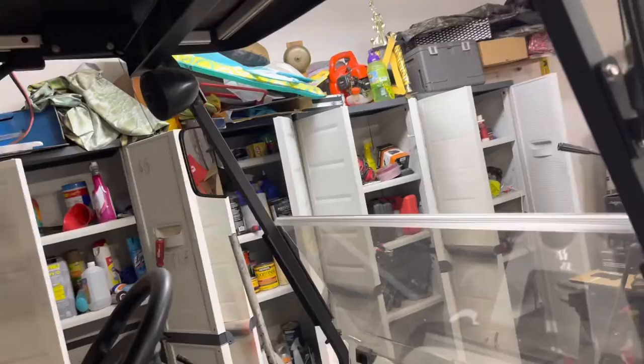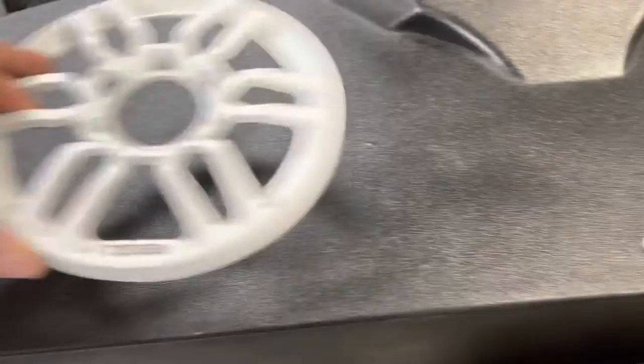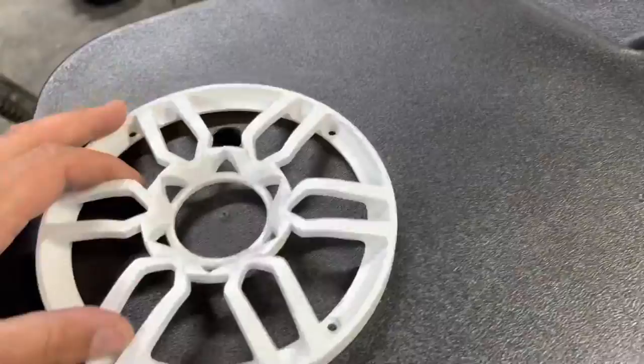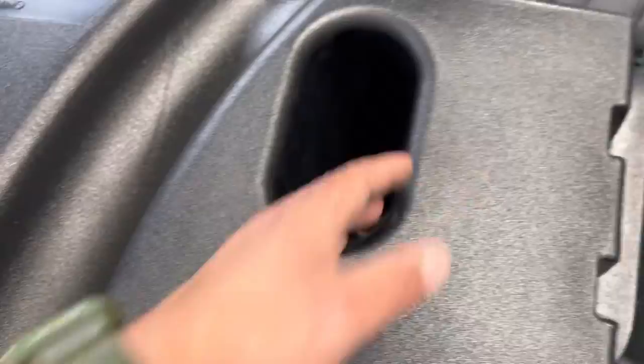So stay tuned — this build is going to be awesome. Let me go over this Frog Head box; it's very nicely designed and it's going to look great. Here's one of the speaker covers — this is a six and a half speaker cover. You could probably get away with some eights on this box, but six and a halfs are definitely fine; eights are going to be tighter. These holes here are obviously going to get cut out. One thing you have to check for is that the interior wall goes all the way down, so you want to make sure you don't cut into that area. As long as we keep the cuts positioned correctly over here and over here, we'll be good.